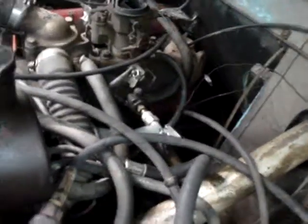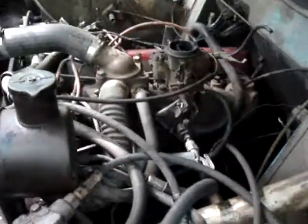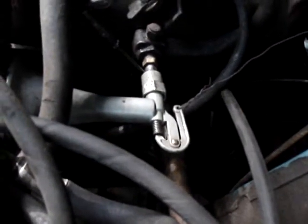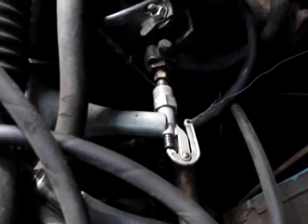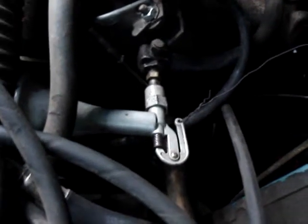The accelerator linkage was kind of rough, because on the 800B it's two inches longer compared to the 800. This rod right here is longer on the 800B, and it took me half the day to figure out I should check the one on the other chassis — sure enough, that was two inches shorter, and everything went right together. And I got my vacuum whistle — that ain't going yet, but it will be. I hope it still works.